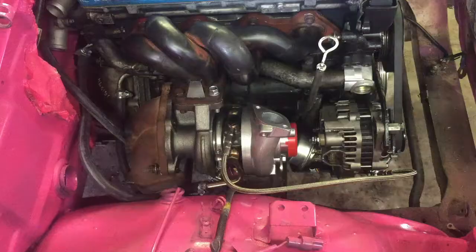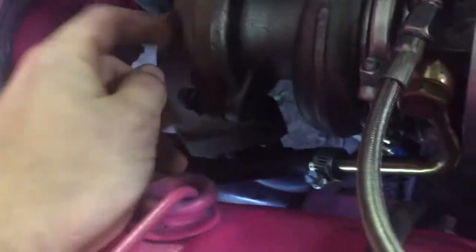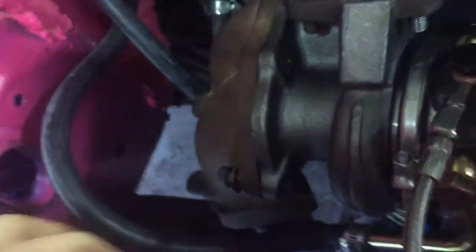Today I'm looking at doing the exhaust, or at least making a downpipe. I need to keep this piece because it has an O2 bung in the bottom of it right here, and I need to keep it shaped the way it is. I'm gonna make the pipe curve and go down — there's a decent amount of room to work with. I've started by taking the old downpipe and chopping the flange off, then I'll put the flange on and see if I can chop up that bend and make this work.